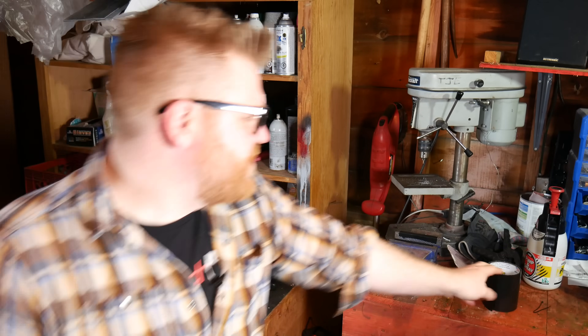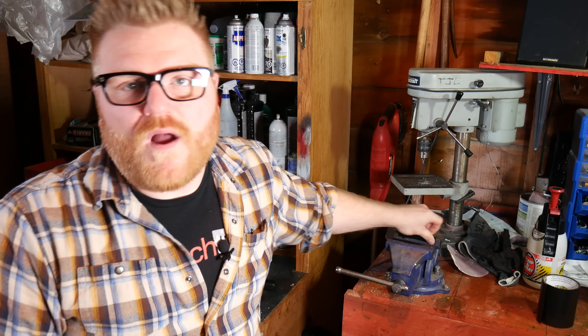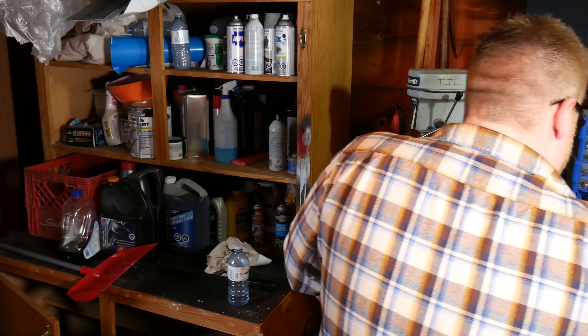I've prepped up the vice. I put some flex tape on the vice where I'm going to use it to eject — flex tape is like rubber, it's going to be a pretty nice surface for it to grapple onto. I cleaned the vice a bit too. I'm going to go very, very slow — super baby steps. I put some tape on the end so I can clamp it in the vice and hopefully the IHS stays put. As soon as we feel a little bit of give, we'll take a second and then give that final crack. It's like one degree Celsius out here.